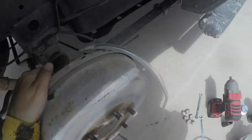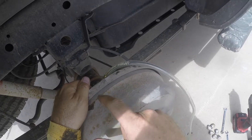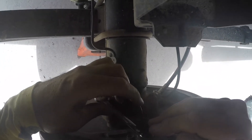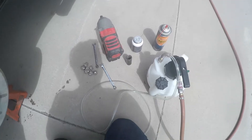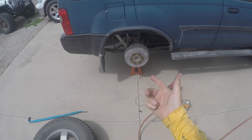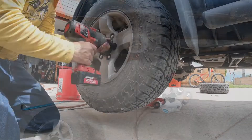What I'm going to do before I close the nipple is turn this on, keep it on, then close the nipple, and then turn this off. Hopefully that way it'll keep any air bubbles from entraining back in. Just leave the suction on — it clears the line, which is kind of nice. It is easier to get to the nipples with the tires off. I traditionally don't do that, I just get into the car and hook them up, but I need to rotate the tires anyway.